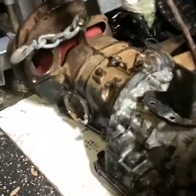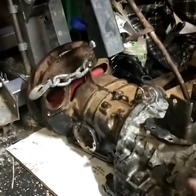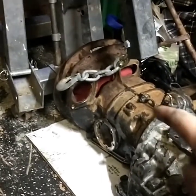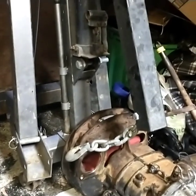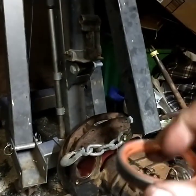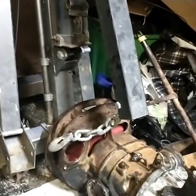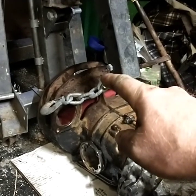You missed some fun unfortunately. Volkswagen says to have this thing mounted on its nose and just lift that heavy cast iron piece off to separate the transmission and the diff. I couldn't do that alone, so I called my brother — he came over with his engine hoist and we were able to pop that off. We went inside and put the new seals on for the diff and the transmission. Then when I went to put the torque converter seal on, I totally goofed and smashed it in beyond where it was supposed to go — I thought it would have a stop and it doesn't. When I pulled it out I damaged it, so I have to order a new one. I also need to order the side cover seals.